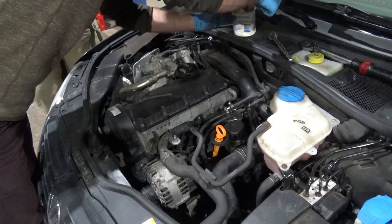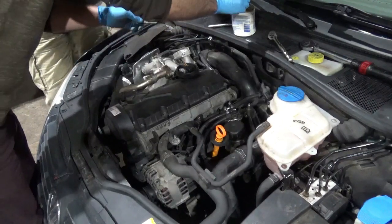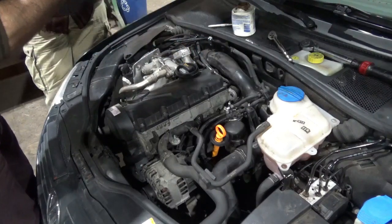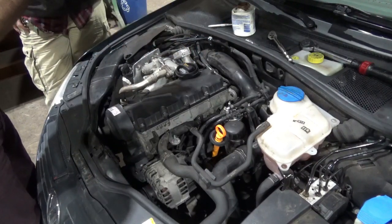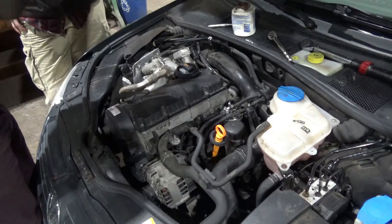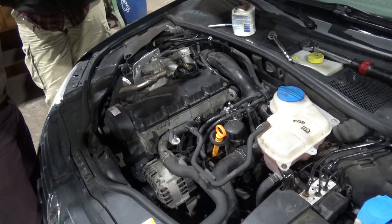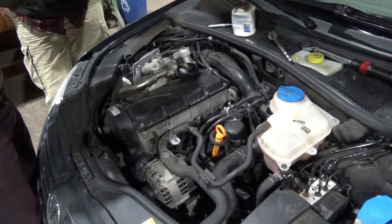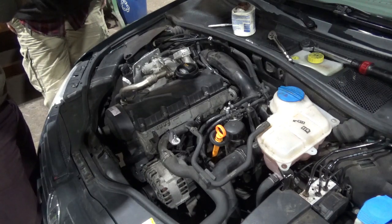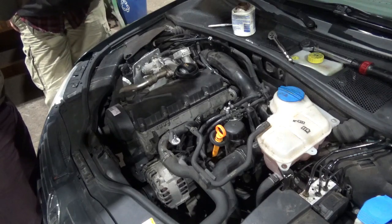No, so like I said, when I'm dealing with low torque fasteners that are small, the breaking torque of these glow plugs is so low. The whole glow plug body shears off at like 25 or something stupid, because the metal's really thin in here. The one I dealt with broke off right here, and then I pounded something in and it just broke off more. I TIG welded something inside, it just broke off lower, and the threads were just roached.